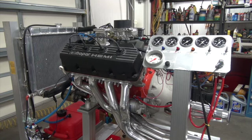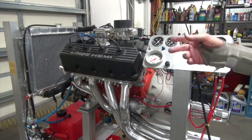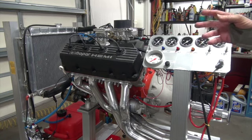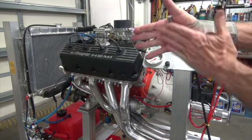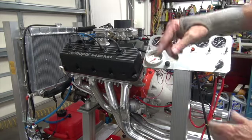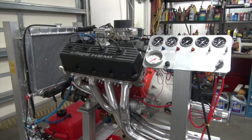and everything went fine. And then I put in the distributor drive gear, putting on half STP and oil mixed all over the gear and where it rides underneath the head of the gear on the bushing and in the bushing again, even though I'd already done it before. And then the slot parallel to the crankshaft, because that's what the factory service manual calls for.